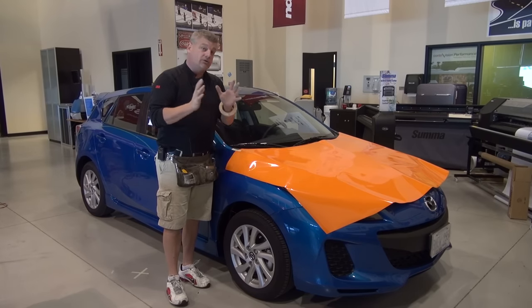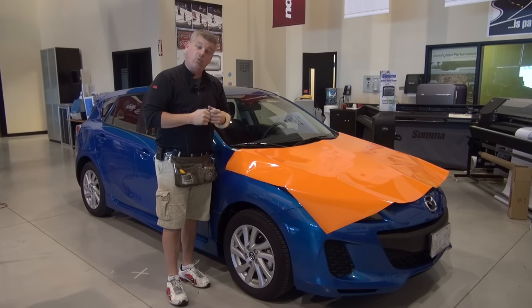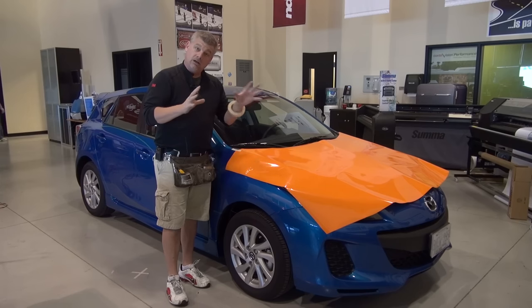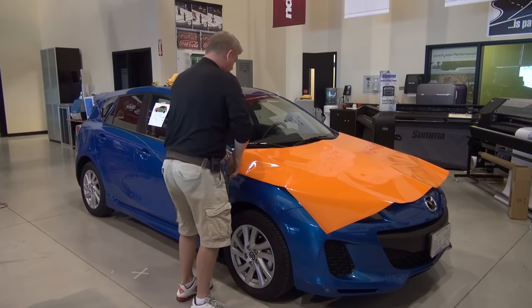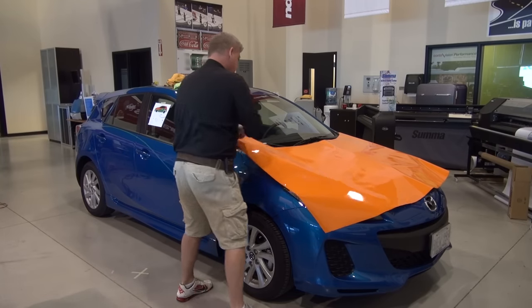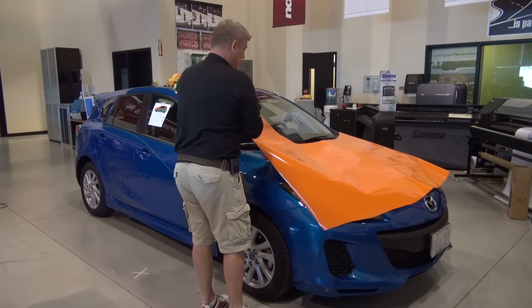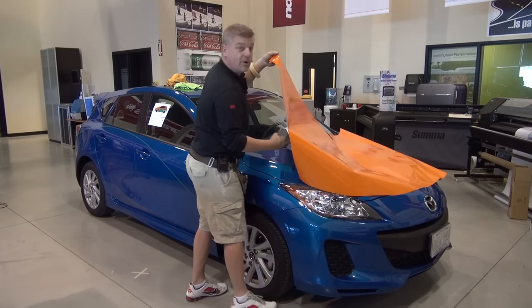So what I'm going to do with all double compounds is start in the center and break it up into four equal sections. And I'm always going to work away from the middle. That way the tension, or that energy of the double compound, is split equally. I've primed all the edges with Primer 94. I've let it dry for about 5 minutes.